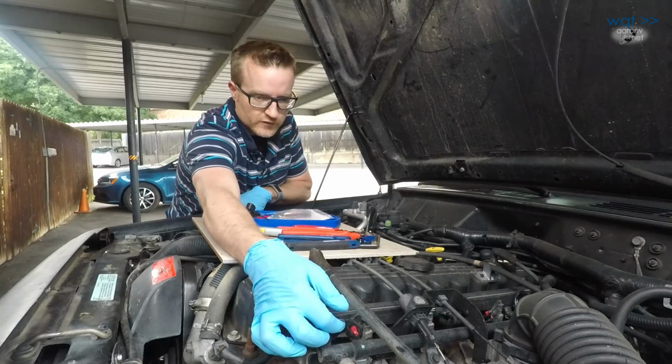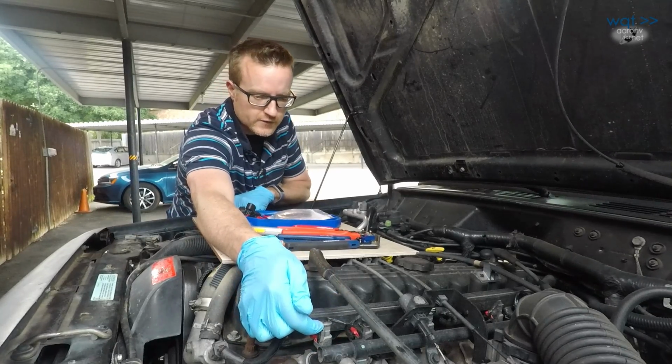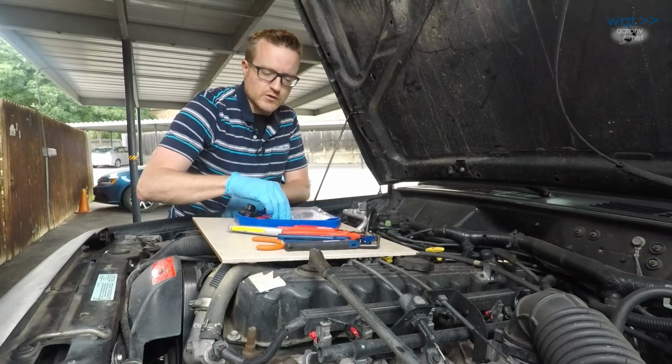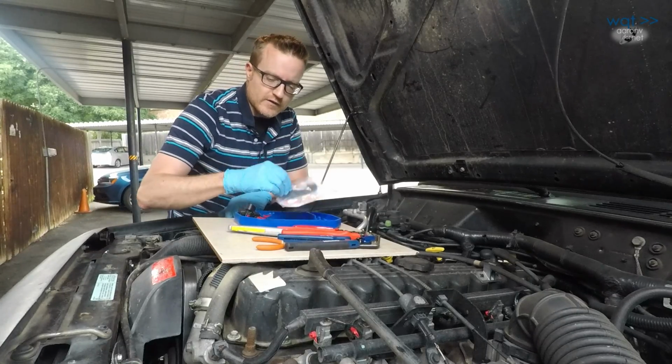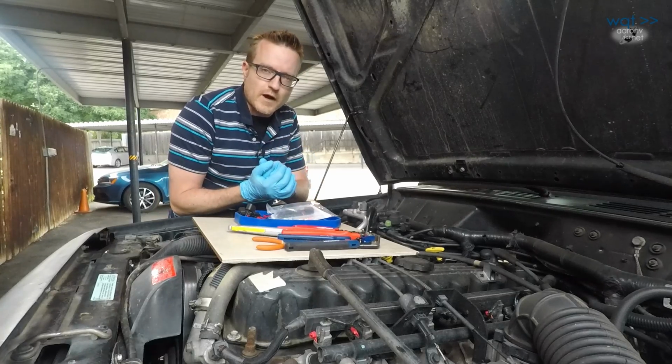But if yours are still in decent enough condition like this to where you could just lop them off at the edge of the connector, then you have the option to do a direct termination, and that avoids having the 2 extra crimps of the splice. The most ideal wire is point to point whenever possible.